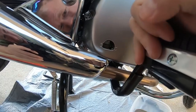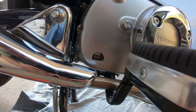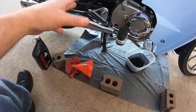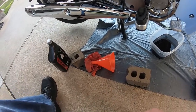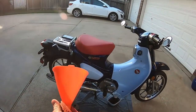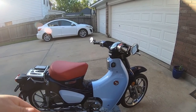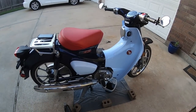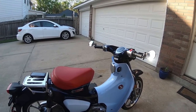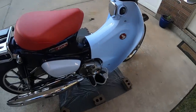After circulating, the level is just a hair under the full mark. We'll run it around, get it good and warm, and check it again to make sure we're not over full. Overfill isn't a big deal unless it's excessive. With these small engines, if you're over full you end up hurting efficiency due to crankshaft windage — you're dragging too much of the crank and connecting rod through the oil bath. Worst case, if you're really over full, you can have blow-by, seal issues, and leaks, especially as the oil heats up.